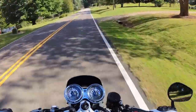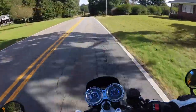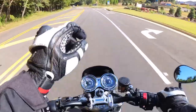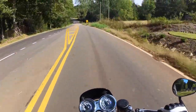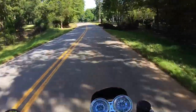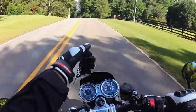But I haven't done a damn thing other than, the DB killers are removable, those little baffle inserts. It's a T30 bit. Reach in there with a T30 bit, give it a good crack. That's like a little tiny drop of spot weld. They just tack it with a welder so that it's permanent and doesn't back out on its own. But you just give it a crack, and it snaps, and then you just unscrew it, and the baffle slides out.